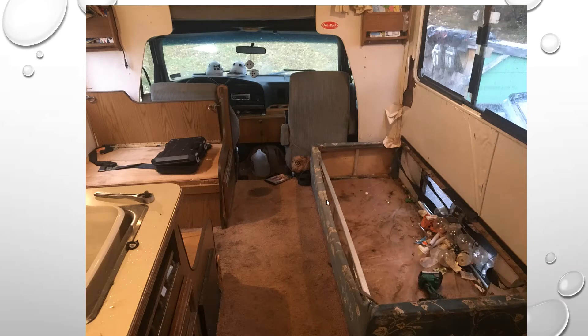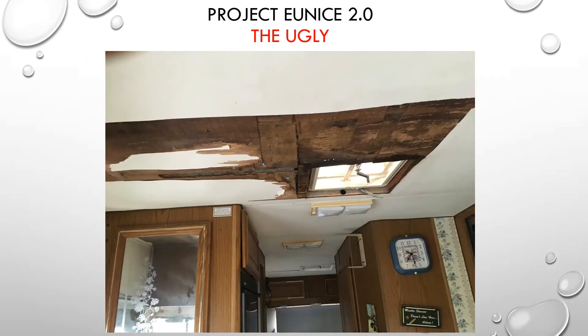One of the other things we saw was the ceiling. It didn't look like this when we started, but there was a crack down the middle of it. I put my finger up there and just pulled down and the whole thing just came down with no problem. That shows how much water damage there was up there — with that crack in the middle, there was really not much structure to the roof at that point, which would have been bad if somebody walked across it.